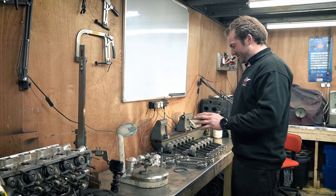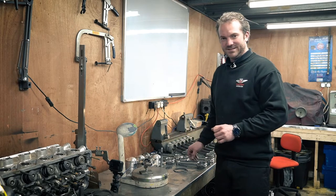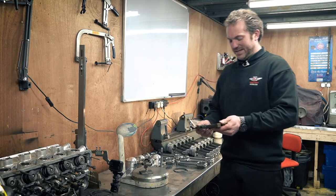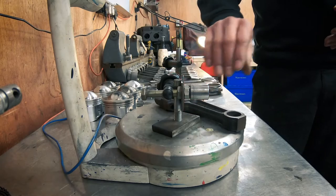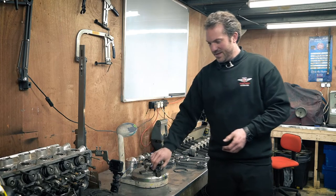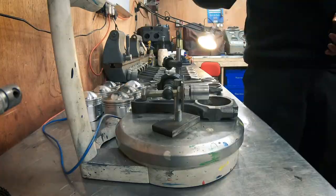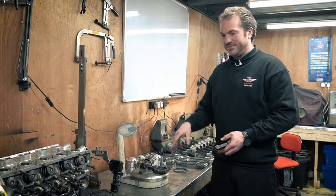The way I like to start — there are loads of ways of doing this — but the way I normally start is with the conrods. So with this old Ford conrod here, for example, I first put the conrod on the scales, measure the total weight, then zero the scales. I get all the other conrods and put them on one by one. I can see this conrod here is 0.8 grams lighter, and I keep doing that until I find the lightest rod.